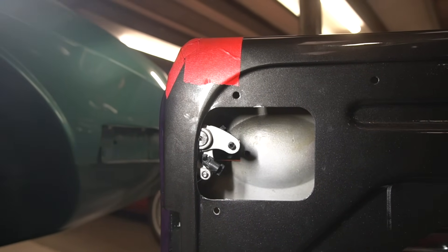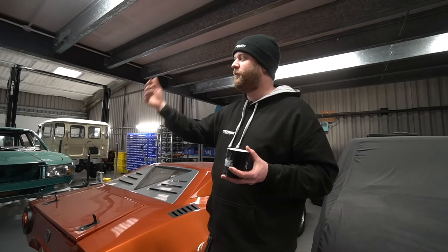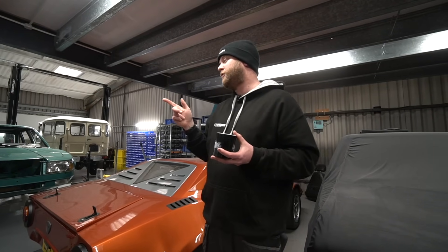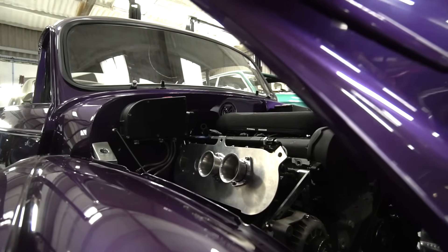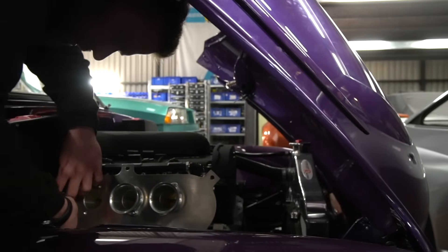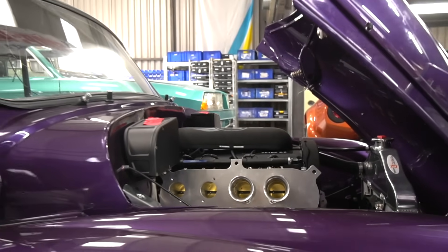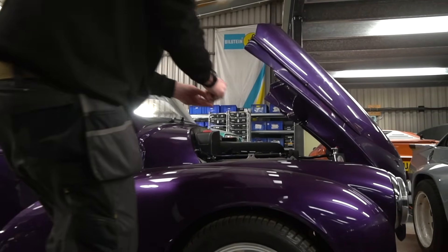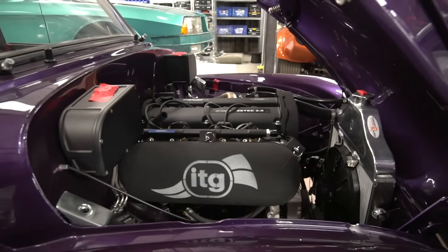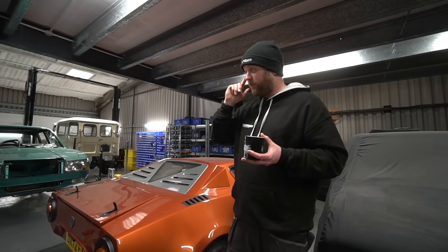That's the keystone for the whole door build because we can't easily assemble the handle mechanism with all the glass in there. As soon as we've got that in we can put the glass in, window lifters, finalise all that, get the door frames on, and button up the whole door build. We also did a little tweak on the air filter - the back plate was slightly too close to the bulkhead and the plastic of the filter casing was just touching it. We've done a revised back plate that moves it another 10mm forward, and gone for a slightly shallower trumpet on the intake as we bring it forward. That's all sorted now; we'll paint the back plate and get it on for the final time.